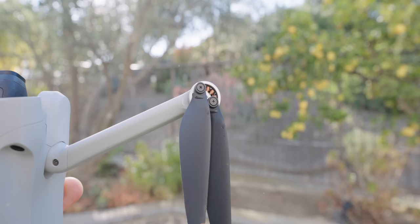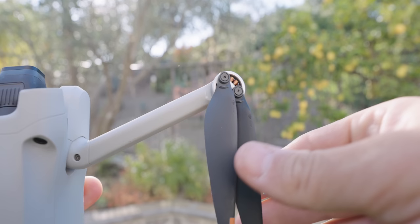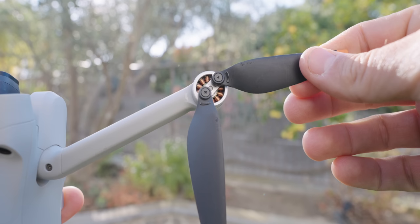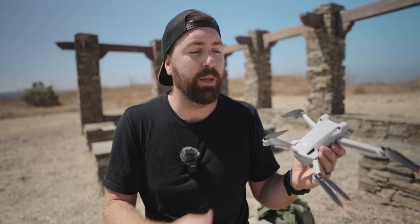The last thing on the drone is the propellers. With the Mini 3, you have to screw on your propellers. If you break one, DJI provides a little screwdriver to take propellers on and off. There are two types of propellers — you can tell which you need by the little notch next to where you screw them. Looking down at the drone, the front right and back left have a little swoop on them indicating their position. The front left and back right don't have this. Make sure you put the right propellers where they go, because the drone won't work if they're in the wrong spots.